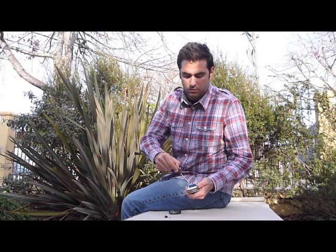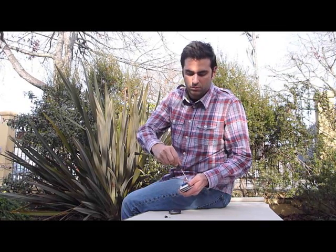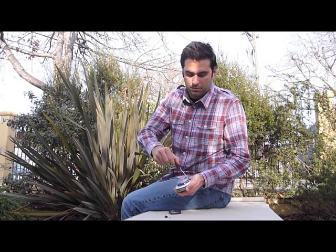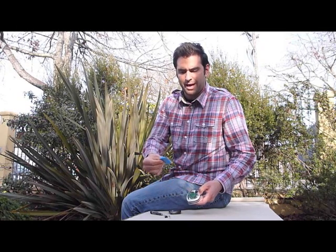So that's one, two, there's the third one, and finally the fourth one right there. Now you're going to note that the battery is stuck down a little bit on some tape — that's okay. Just go ahead and pull it out, pull that battery off just like that, and you can go ahead and pull the top casing off of the battery as well.